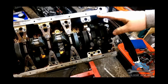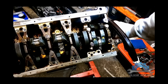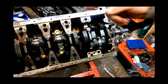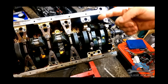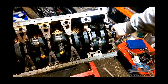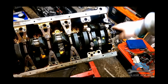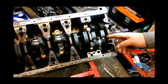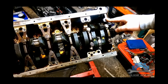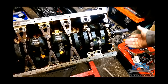When you finish that, you're not going to be able to crank the crankshaft with the pistons installed by hand. Don't worry about that — that's normal, because you did honing and you have new piston rings, so there's a big tension. Each time you install more pistons there's going to be more resistance. You will be able to rotate the crankshaft with a spanner or ratchet.